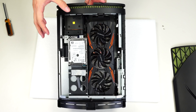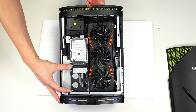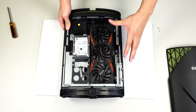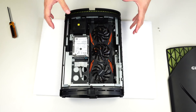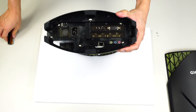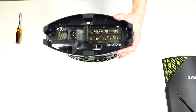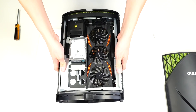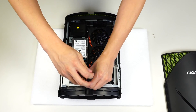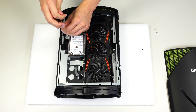Last time we showed you the screws that allow you to install additional hard drives. You can install a 2.5-inch SSD or HDD here if you want to upgrade. There's also a full-length graphics card here, and there are three screws you need to remove to take it out. The first screw is at the bottom right in here — just find a screwdriver, unscrew it, and you'll be able to take the graphics card out. To properly lift the graphics card out, you'll also need to remove the hard drive bay. There's one screw at the center bottom of the chassis, and another one here on the right.